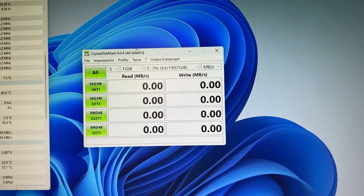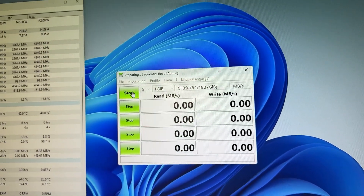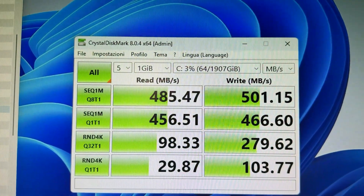We know the SSD is SATA M.2, which means it has a theoretical cap of 600 megabytes per second. I ran Crystal Disk Mark and it went pretty much as expected — basically the same result as a SATA SSD would, in the 500 megabytes per second range. The good thing is it wasn't really dropping even at 4K, and performance was very consistent overall, which actually surprised me positively. I went ahead and installed my whole game library on the drive — it slowed down a little after we surpassed the 500 gigabyte point, but in the benchmark it remained roughly the same. That means the 2TB they claim is actually real, but it is very slow SATA storage. They claim some kind of cache, but that's clearly not the case — it is basically a SATA drive rebranded.